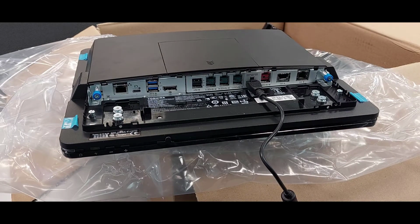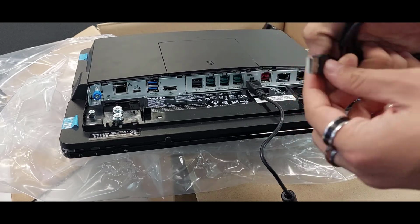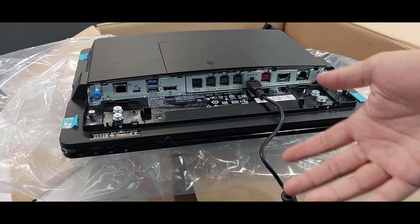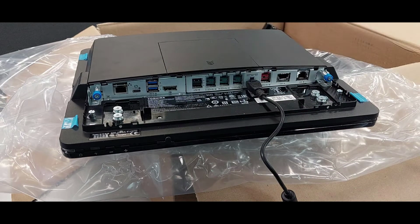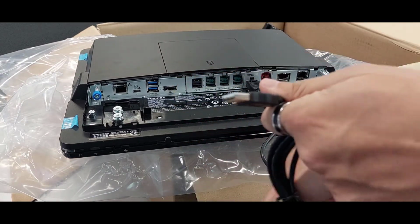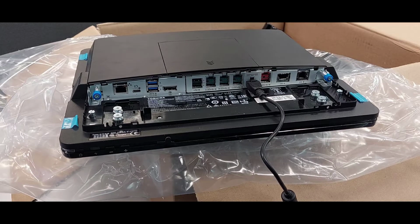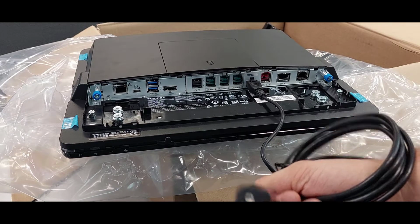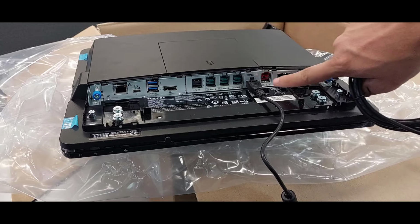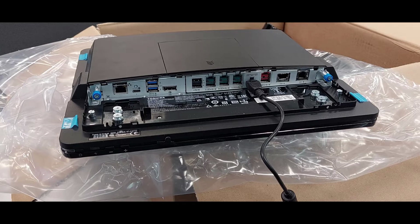So if I was to open this up, this is what it would look like. So you got your serial here, USB there. So when you're swapping one, especially an all-in-one, you would unscrew the serial, feed it back through the pole, down underneath the counter, wherever it goes, screw it into this, and then feed the USB back up through the pole and into either the USB 3.0 or 2.0 on the Toshi. All right, that's how you feed that through if you have serial. So if you are swapping all-in-one to all-in-one, serial goes into that, USB goes up, ditto for any USBs, and you would just remove the power from the original one and put the power for the Toshiba through the pole to get it working. That's it for the Toshiba.